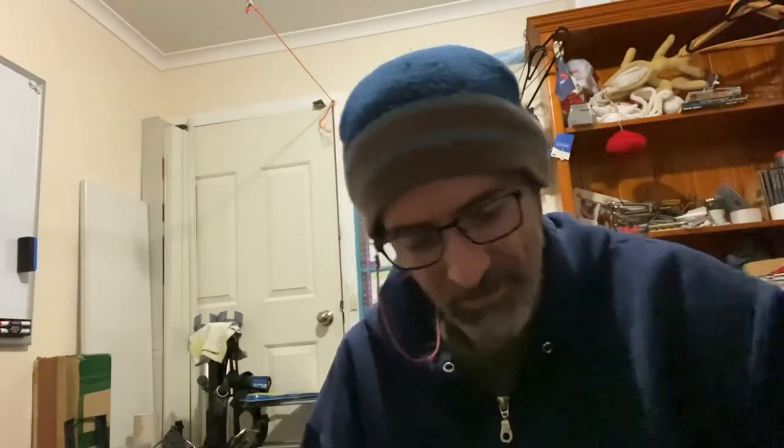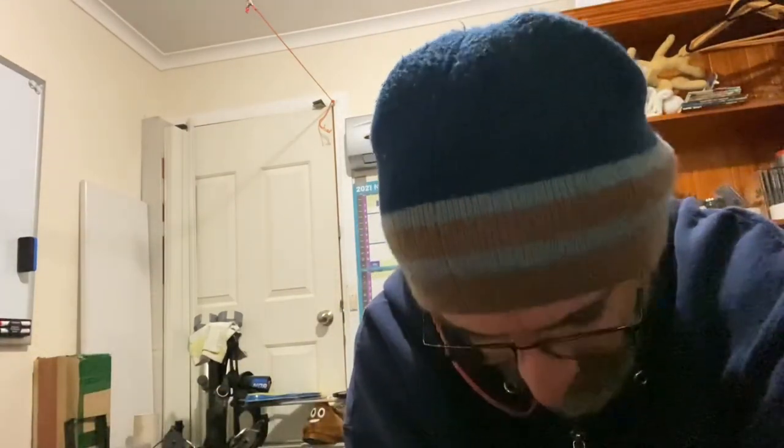That doesn't sound so bad now. That's because the little fan bit inside it isn't spinning. So it's probably going to get hot a lot easier. But at least I diagnosed exactly why it wasn't working, and that was the brushes. But I had a feeling that there was a fair bit of damage because of the way that it had overheated and blown smoke. And that was all the plastic melting. Anyway, a rescue drill, but not the greatest of rescues, I think. I don't know.